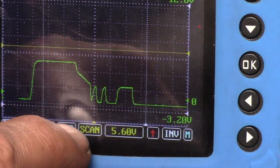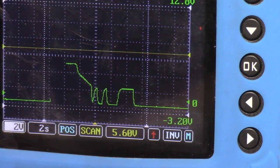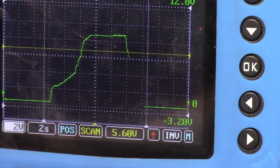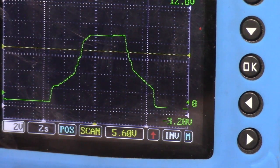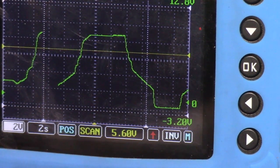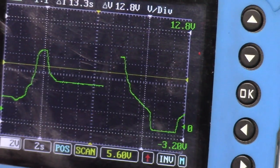Now watch the control signal as I go up — and back down. It's off. As you can see — wait for the screen to refresh — you can see we have a consistent control signal for the blower. So what we have is a bad resistor — that's the final stage unit. Let's get that in.